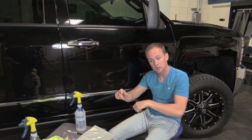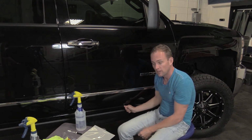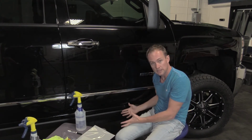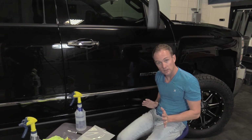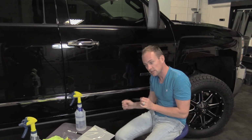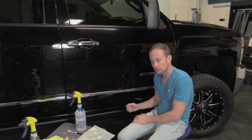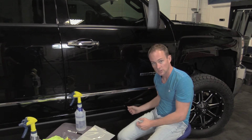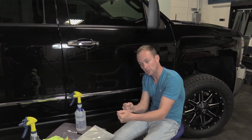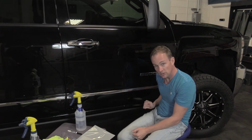Okay, then you put the cap on, you flip it over, and you go ahead and apply your touch-up paint. The most common mistake is putting on too much paint. So you have a chip, and you get this big glob of paint on there. You just want to put a little bit on there and let it dry, and then come back and put a little bit more on, let it dry, and put a little bit. Just add these little coats. Okay, if you just put this big glob on, it's not going to be smooth to the touch. That's most likely going to lift off with the bra if you have to lift the bra to reposition or do anything with the material that way. So I'd recommend just a light brush in the chip.